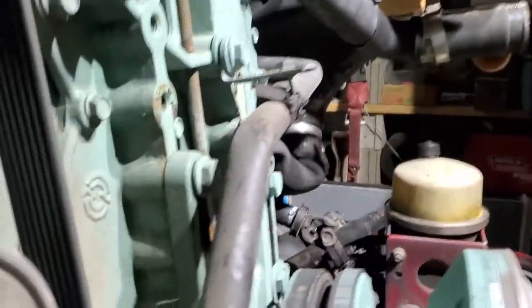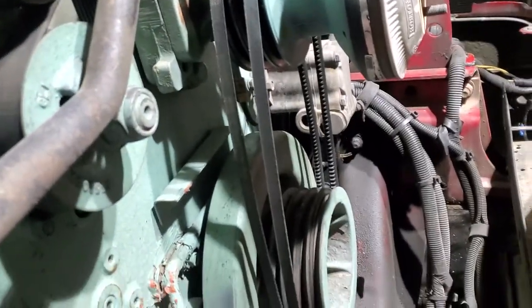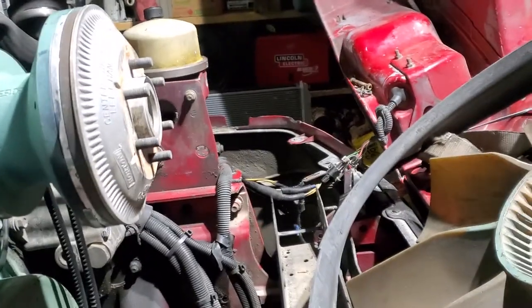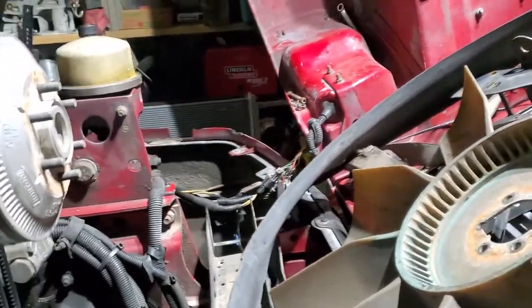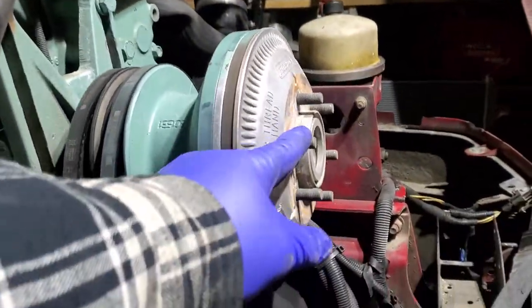There's three bolts. I'm replacing my radiator, so obviously it's very easy to do this. I would have checked the belts regardless, being that this would definitely be the time to do it. You don't have to pull your radiator to do this — it's just a lot easier right now. Basically, I would just pull the fan shroud, loosen it, and just push it towards the motor so you can take your fan off.